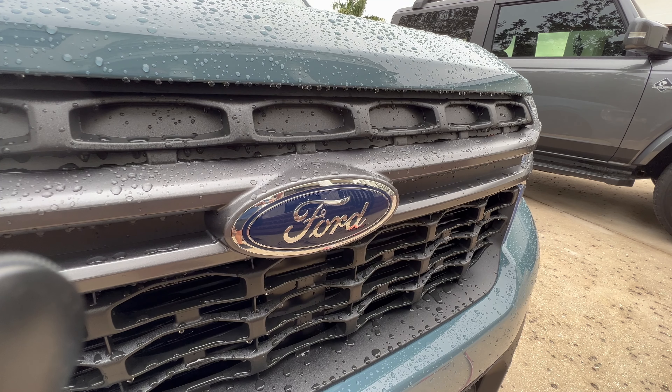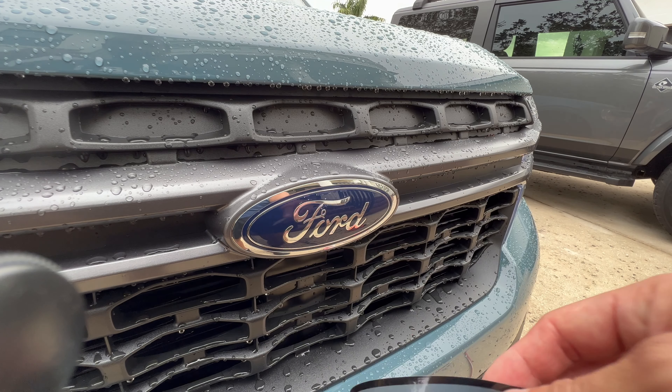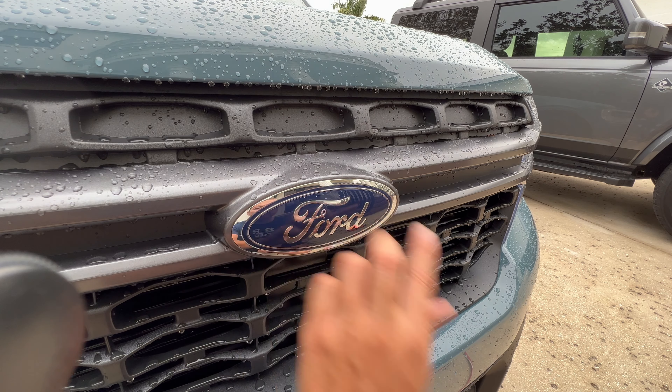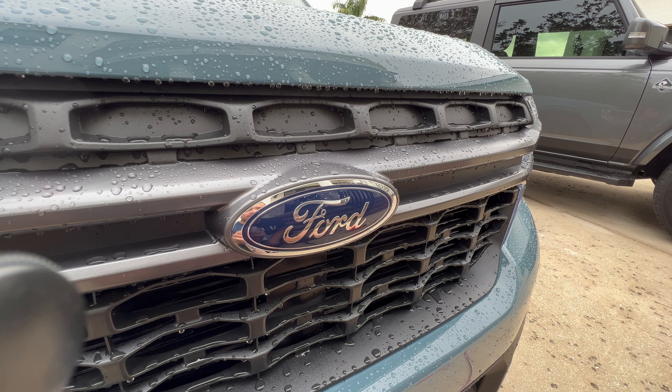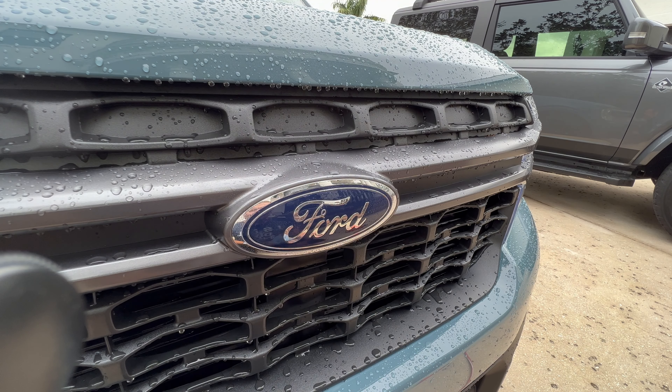If this is the first video you've seen from me, you will start to see the same reoccurring themes. Things I repeat — things that you should take to heart. Once again, it is 70 degrees. I like to install these vinyls between 70 to 80 degrees. The vinyl reacts to heat and sticks really well at this temperature. If you are in a super frigid environment, you might have a little harder time installing this.